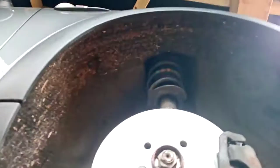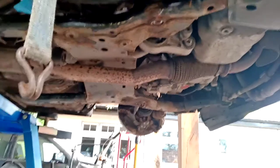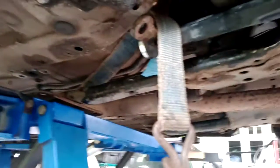Welcome to the next video. This is a follow-on from the MINI convertible — the R57, 2009-2011 era, probably the same as an R56. Bear with me because this is a new phone so it might go out of focus a little bit. The job we've been doing is replacing the lower trailing arm bushes. There's the lower trailing arm here, with the inner ball joint — you can see it's loose at the moment — and obviously there's the bottom of the hub. Big job, messy, horrible job.